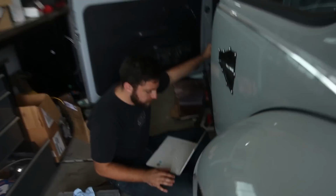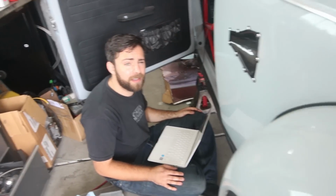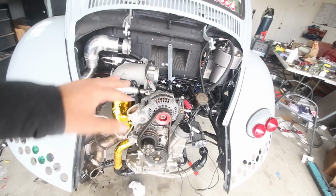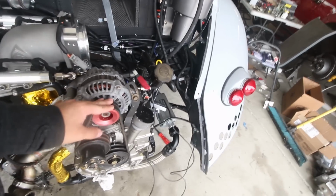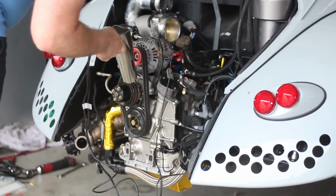Calibrating the thermistor tables and MegaSquirt real quick, and then we're gonna try to set the ignition timing so that it actually matches what the ECU is supposed to see. He's doing base tuning. Just basically the bare minimum to get it running, and we'll go from there. As long as you have fuel and it's relatively in time, it should start.